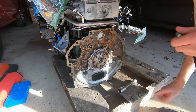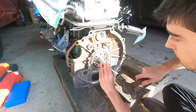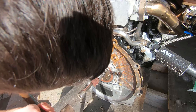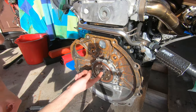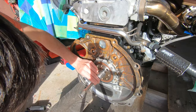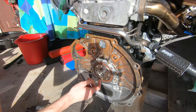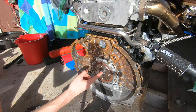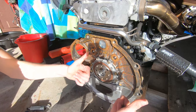We're just going to hammer that right into its spot on the crankshaft. Going in nice and smoothly. Make sure it still spins nicely after tapping it in, and give it a couple more taps to make sure it's seated. You can't push the bearing in too far — there's an inner lip inside the crankshaft slot where the bearing goes, so just tap it in until it feels seated. It spins nice and freely. That is your new pilot bearing installed.